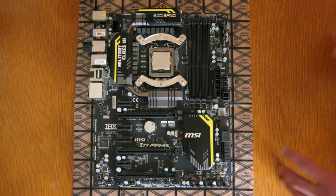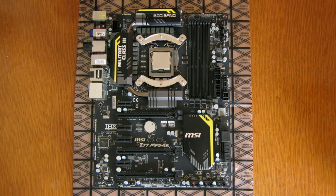This is the BIOS button. Basically how this works is you push it, and then next time you boot the board, you'll go into the BIOS. And this is good because sometimes this board in particular will boot past the BIOS into the Windows screen extremely quickly, and even more so if you've got Windows 8. So in some cases, the post screen will go past so fast that you don't even get a chance to press delete. Or if you just say, oh, I want to go into the BIOS next time I boot the system for whatever reason, you can just give it a press anytime, whether it's off, on, booting, or whatever, and it will go into the BIOS next time. So that will actually remind you next time you boot to go into the BIOS and do what you want it to do. So that's actually very useful.